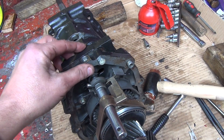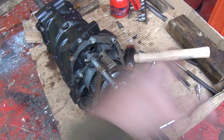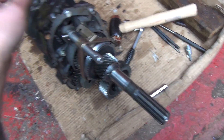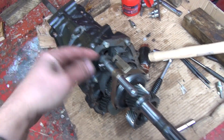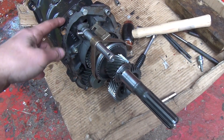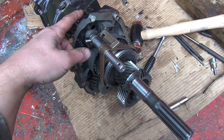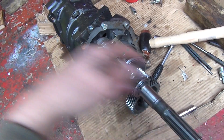Then I've got two slave bolts holding this in — probably should use more but two should do for now because I've stripped a couple of them. So that's pretty much it. Once I've got this nut tied on properly I have to take the casing back off, get it out of gear, sort the selector rail out so it's all in neutral, and then put some gasket seal on between the two extensions — centre plate and the extension — and then put it all back together again and look to put the front part on.